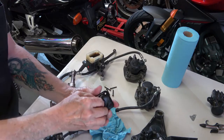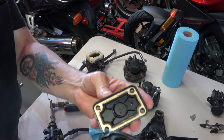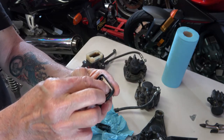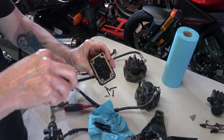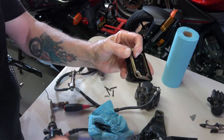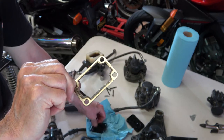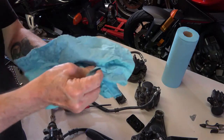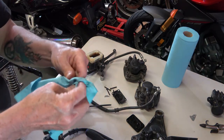So I'm showing here how to take the old cap off, then you pull out the rubber insert off the cap. When you peel it open you'll see it — it's a cad-plated metal backing plate. What that does is when you tighten down that cap, you have a nice solid metal surface for the gasket to seal up against. If you don't put that in there, I guarantee you that reservoir will leak. Unfortunately, none of the rebuild kits or new reservoir cups come with this metal plate, so you always have to make sure you get it out of there.